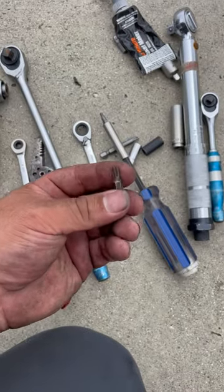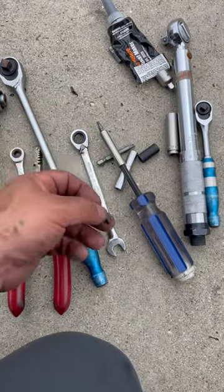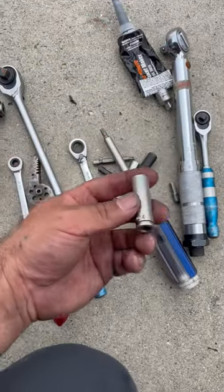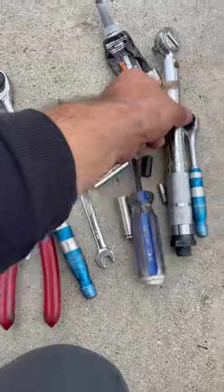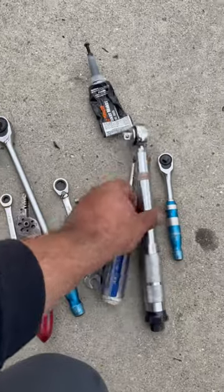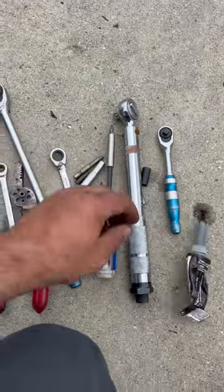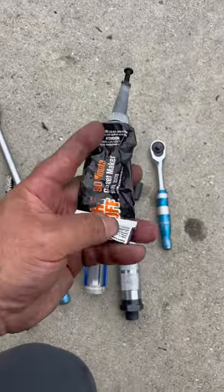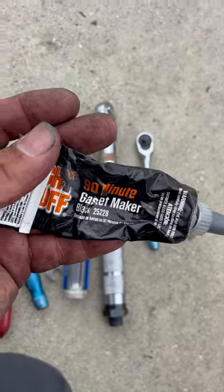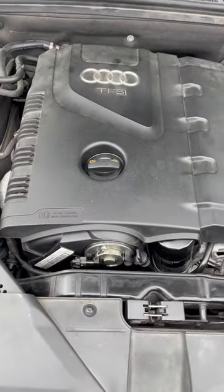This one is a T26, and this one was just for the PCV cover — that's what type of screw it had. Again, these were just adapters and the 10 socket as well. You will need a torque wrench to put the specs back on the valve cover screws. This is the silicone that I used — works really well. It's a 90-minute gasket maker, so it dries in about 90 minutes. Engine's all put back together — let's just hope for the best now.